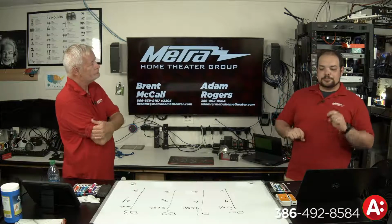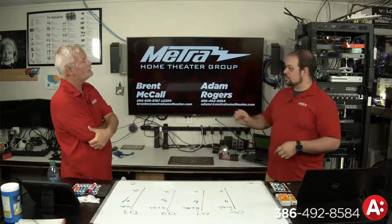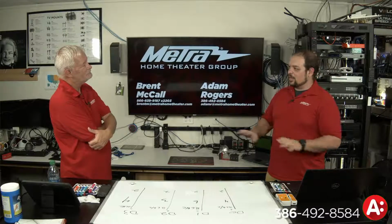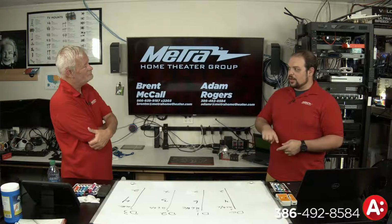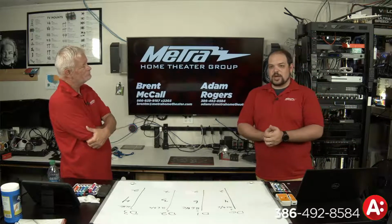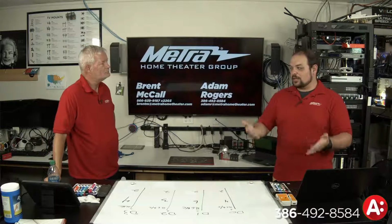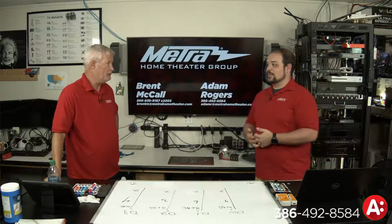From there, he's going into a Samsung. And we know it's a Samsung because he turned off AnyNet. He specifically said AnyNet. Now, he's going from the FiOS through all of that, and he's not going through any audio system whatsoever. He's just going directly to the TV. Our extender has a loop out, and that hasn't been plugged in. When he goes into the FiOS box to program the remote, there's no way, at least from his understanding, to program that remote separately from the EDID information that the cable box is receiving back. It's attempting to take you out of the equation.